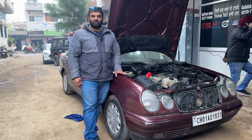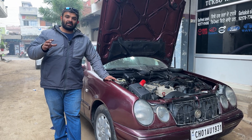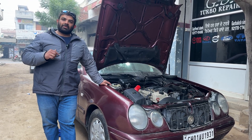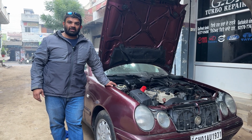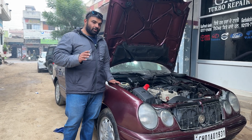This is going to be the most important update on the turbo install — almost everything is in place. The pump side we've not touched as of now; we'll get it running like this, get the exhaust completed, and then the pump has to be disassembled and sent away for a rebuild. The plunger size has to be increased — I'll take that up in detail and discuss it further.